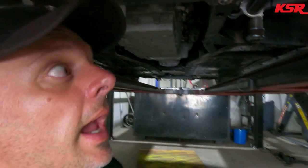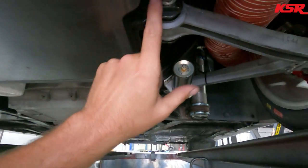In the series that we're doing with Trans Am, the Pirelli tires seem to like a good bit of camber. So we end up with a pretty aggressive camber setup in the car, more so than we used to have with the old Hoosier tires that we were running. And because of that, we had to make these custom camber slugs to slide it out. We have a kit that's got a big range of them for all kinds of different adjustments, but once we were beyond the adjustments, we were no longer able to balance the sides to the numbers that we needed to get. Anyways, let's dyno. Let's make some noise.